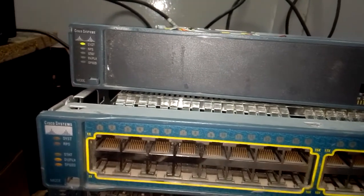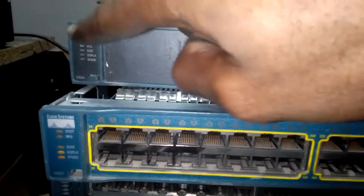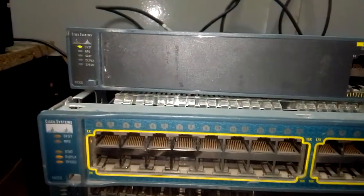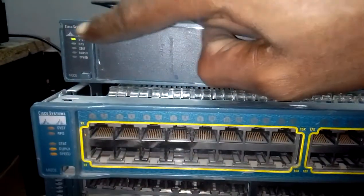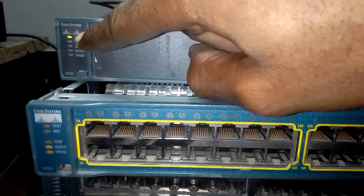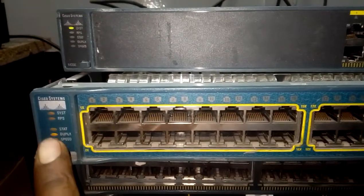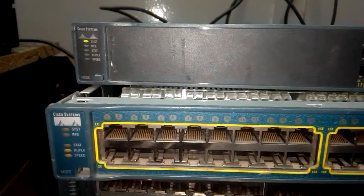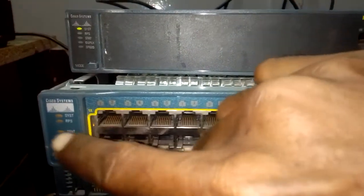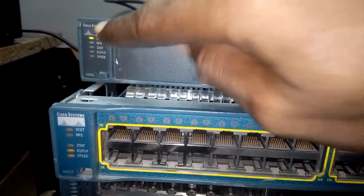You are seeing both of them right now. This is the amber light - this one is amber light. And this one is frozen boot. I'm going to show you the reason why it is called frozen boot. It's not blinking like it's supposed to be. If you are used to Cisco switches, you know that this one is supposed to be blinking. All the lights are steady on - the amber light is orange color. This one is only grey. There's a difference: this one is amber light and this one is frozen boot.